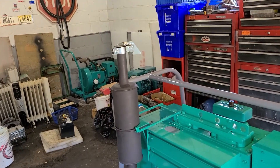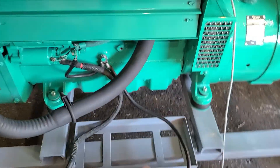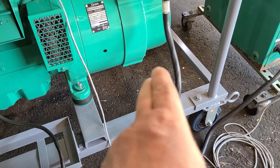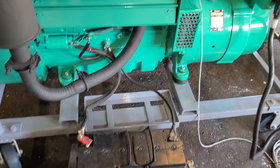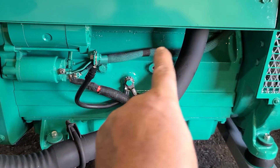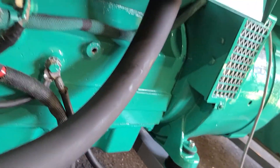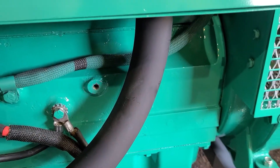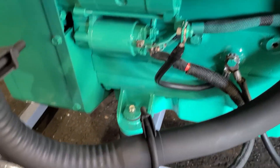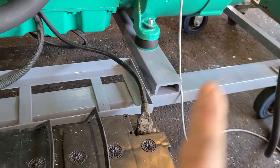It's all set to rock and roll. I haven't fired it up yet. One thing to point out: with the exhaust system rerouted, I can't fit my battery onto the battery tray I made because the pipe comes down close to it, so I'll relocate it and weld a cross member for support. I also have to watch out for the starter cable going in back of the exhaust pipe — it's fairly close, maybe a couple inches. I've got insulation on the wires and I'm going to put exhaust pipe heat wrap on this pipe to protect the starter. We'll clean that up when we relocate the battery.